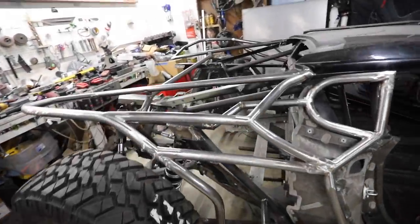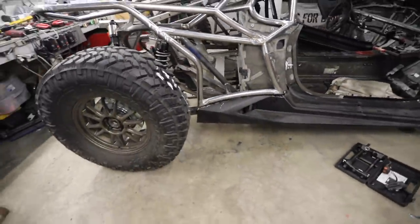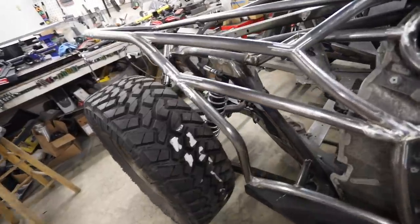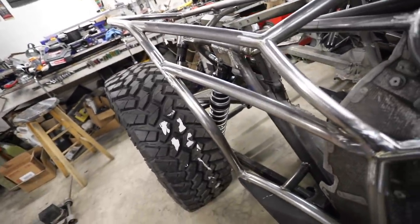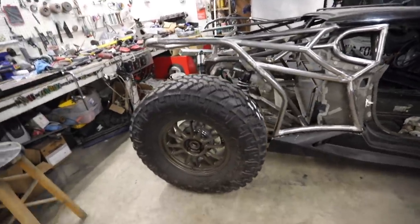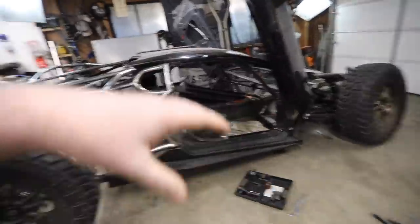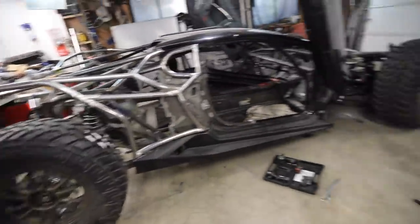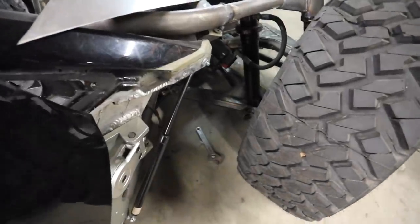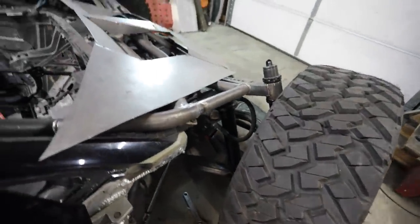Springs are installed on both sides. We gave it the old jump test and it got quite low. So that's a little bit concerning, but we don't have a lot of preload on these springs right now. And that may be a thing that we need to do — preload them a lot more so it doesn't sink as much immediately from the base weight. We're going to find out a lot more once we get the front ones in and also once we start to get the engine in. So we're going to go ahead now and attempt to do the same exact thing on the front. It's the same shock as far as I know, so it shouldn't be too hard.